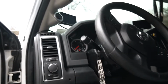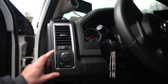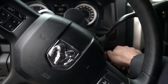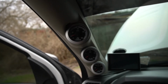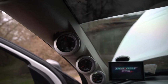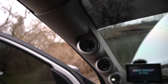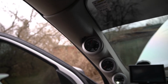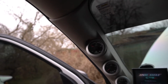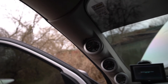So let's turn the key on real quick, test the dimmer function before I press the headlight switch back in and put this little panel back. Moment of truth with the dimmer. So our fuel pressure is reading 18 psi. That's a good thing. The lift pump is currently priming right now, even though you can't hear that Airdog whispering nice and quiet like a G5 jet. And now it's dropping because it is done with the priming process. Of course, it will go back up when we fire the truck up.